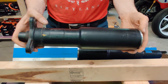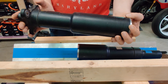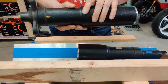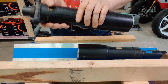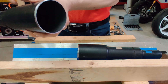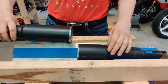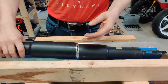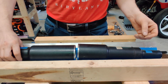You can see the original weight applied on this piece — I think it's mostly to compensate for irregularities in this heavy cast iron piece, which is the heaviest part of the drive shaft. The stainless steel tube is pretty uniform so it doesn't really introduce any imbalance, but if my weld is not very uniform it could put it out of balance. We will see.